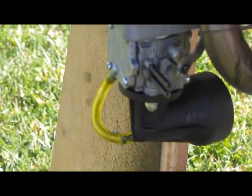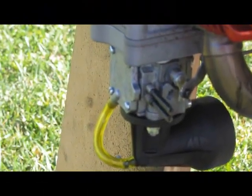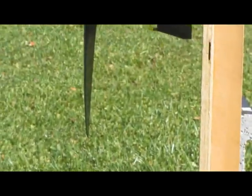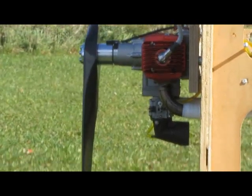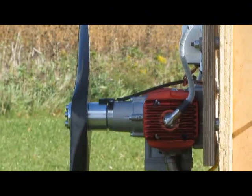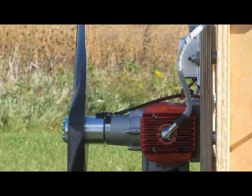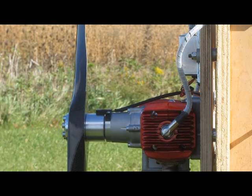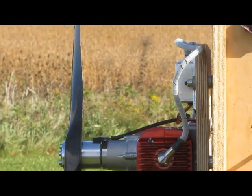You can see it there with the pressure tube. So I have been playing with it, just seeing if I could get some more RPMs. Had to adjust the needles a little bit to get it to run smooth again. But at the end of the day, all I can get is about 5850, so I lost about 150 RPMs by putting that snorkel on.